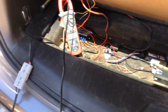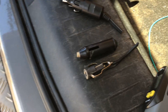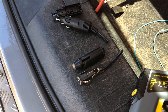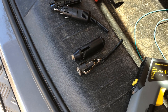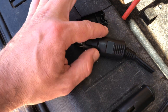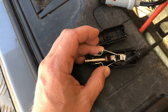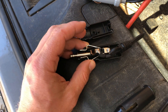But what is more of interest is the plugs that I recently changed. So this was one of them — when it was a hot day, a 40 degree day, I was getting 60 degrees at the plug measuring it. And same with this one here too. And this one, whether you can see it or not, actually started melting. This is the Merit combined Anderson and cigarette lighter plug — bad plugs.